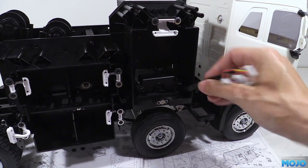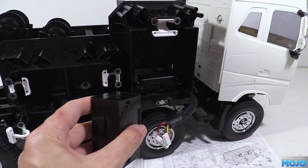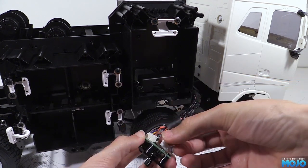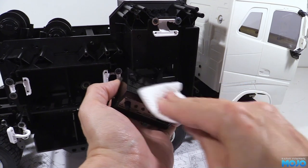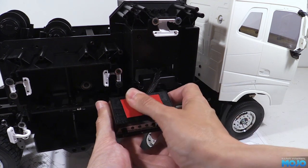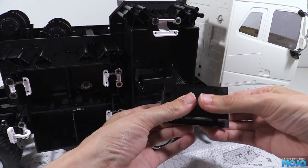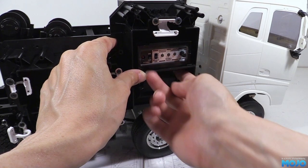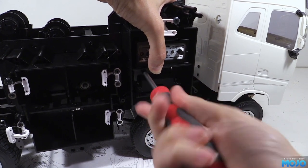To fit the box when using an MFC you're going to need to feed the control wires through the big hole at the bottom as you offer the box up to the chassis. Make sure they're not going to get trapped or pinched as you're doing up the screws. Tamiya recommends starting with the rear most screws then doing the rest — but just like before, as long as you install them all loosely first then tighten them it doesn't matter too much. Once they're in we can fit the MFC control box. To connect it we first need to take it apart to get at the connectors — not the best design but it works. At least all the connectors are different sizes so you don't have to think about which goes where. Clean the bottom with alcohol to remove any grease and clean the top of the shelf too, then use some servo tape to stick it down. Slide the shelf in and install the two self-tappers — the gap at the back isn't very big so you might have to wiggle the wires a bit to get them to lay flat so you can get the shelf all the way in.